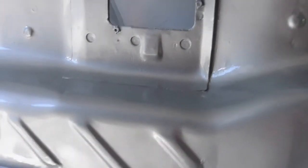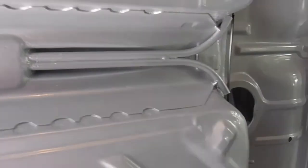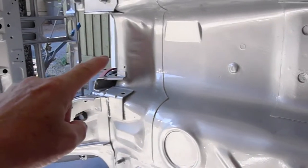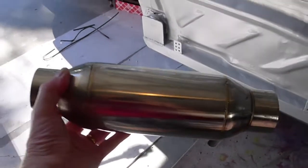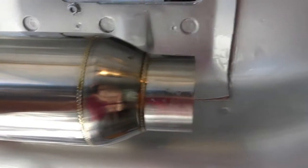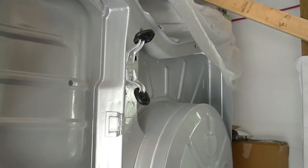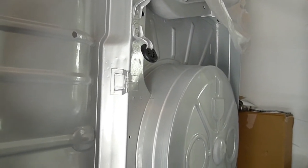The guys at Tectonic said the exhaust system won't fit without cutting away the hangers, so I've cut them all off. The race header itself will hold up the whole front of the exhaust, and I'm going to put a stainless steel brace between the header collector and the engine block, triangulating the header so it's rigid. Then there's a flex pipe, followed by my new Vibrant resonator — a nice little nine-and-a-half-inch unit that tucks in right behind the flex coupling. I'll keep the second Tectonic resonator as well, so I'll have two resonators in a row, then the Borla exhaust. I've already cut off the flange and cleaned up the rear tailpipe.